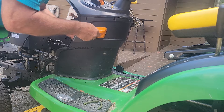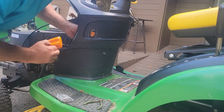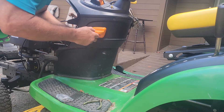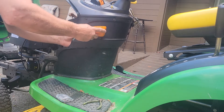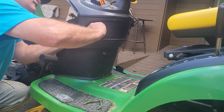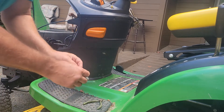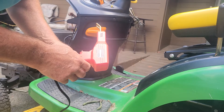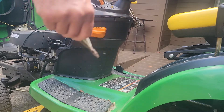There we go — line this up, hopefully no damage on the rest of it. Press the brake down, it should click like that. It's on! Now, I used about 10 of these little parts. I think this thing works great. This is a plastic welding gun, Model H50 — it's a 50-watt Chinese model. Comes as a kit — you get a pair of snips, four bags of these little welding clips, and a knife.